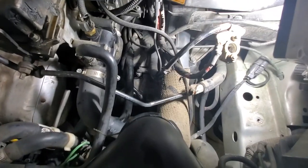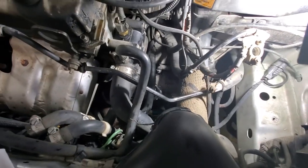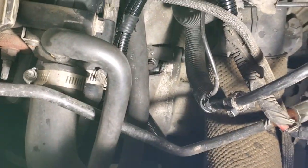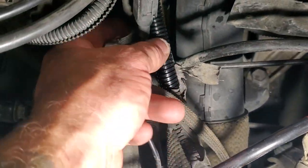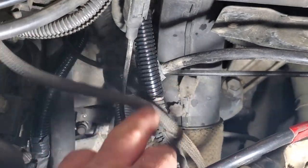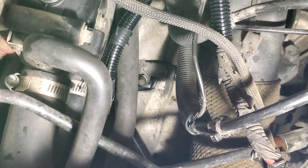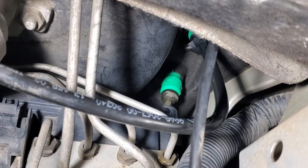Come back inside and feel your pedal — make sure it feels normal. It did take a while on the bleeding because it was really loose, but now it's firmed up. With that all bled, go ahead and clean up all this brake fluid with some brake cleaner. I went ahead and put some protective plastic wrap around some of these wires since that stuff was just falling off and falling to pieces — so brittle. Be sure to double-check for any leaks, and it looks like we're good.